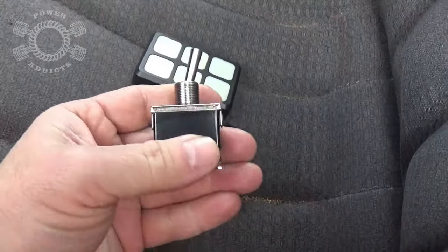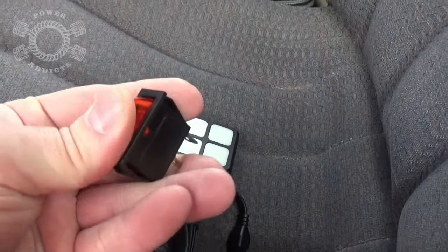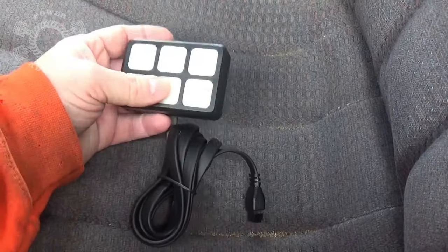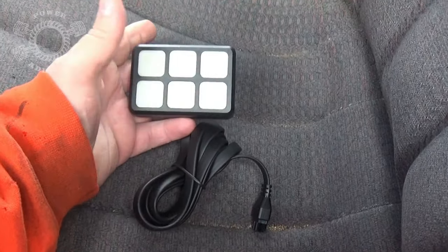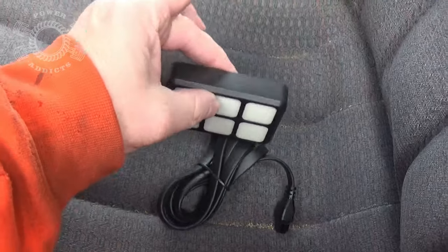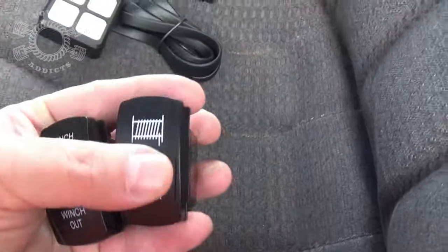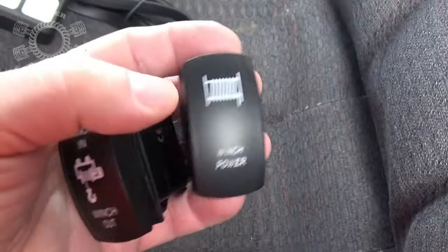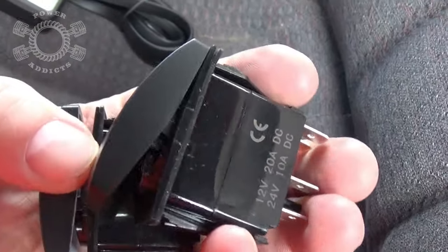Another thing you're going to do is figure out what kind of switch you're going to run. You've got your regular toggle switches, rocker switches, or these new multi-panel switches. When you push one, it activates the internal relay and turns on whatever accessory you assign to that particular port, and then you put your little decals on — that's a video for a later day. Or you can get a winch control switch that actually has winch labels on it: winch power, winch in and out. Don't get these confused. Winch power is simply on or off — two positions.